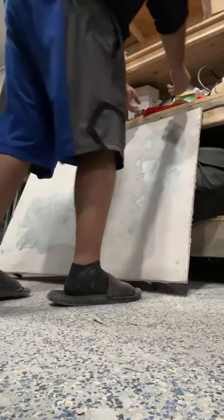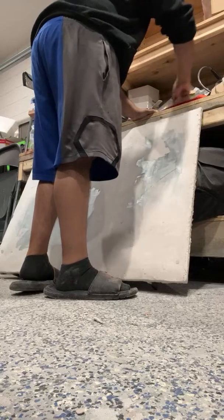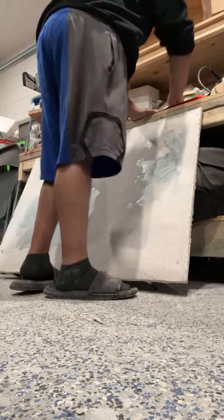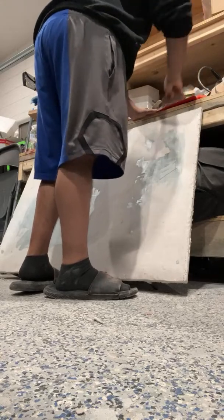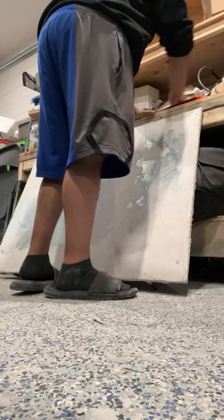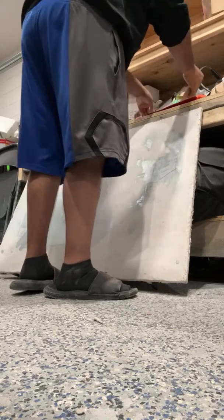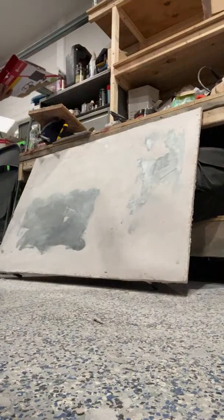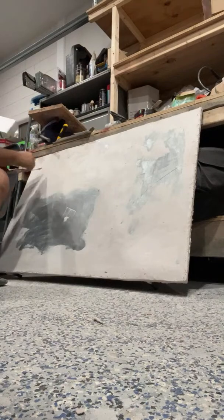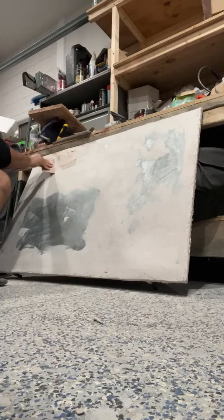You'll see me work. And we will mix this right here. Probably see my booty, but it's okay. Bear with me for a little bit. Just mixing this Bondo a little bit quick. Alright, so the Bondo is nice and mixed. Let's get to spreading something somewhere. So we're going to spread on this area first because it is where most of our depressions are.